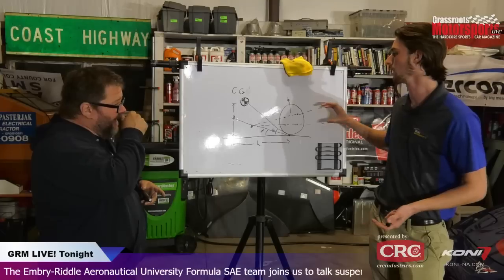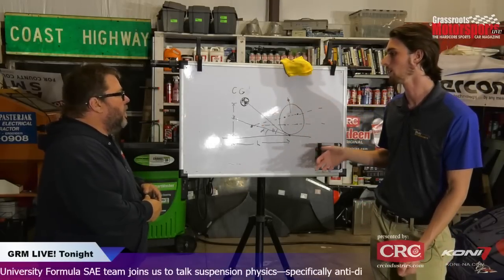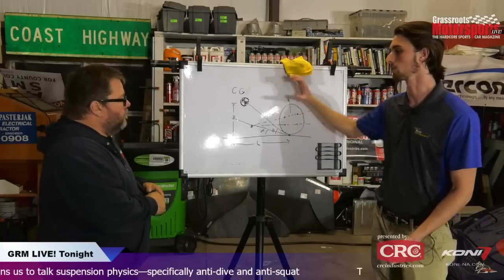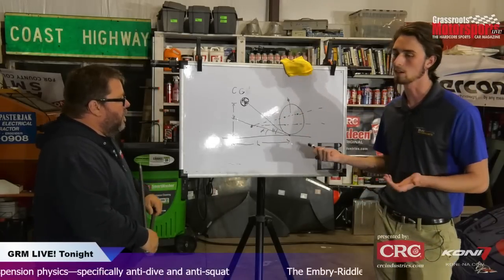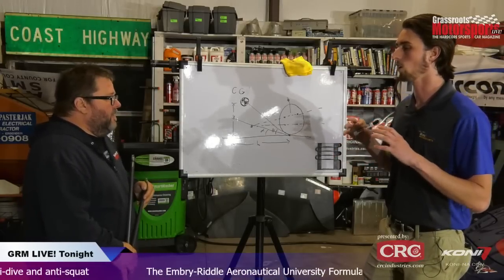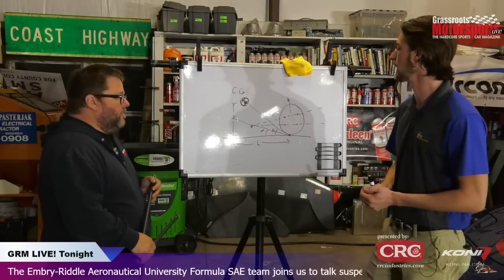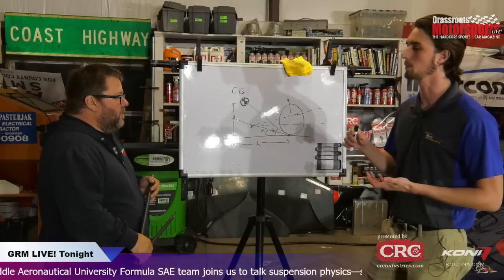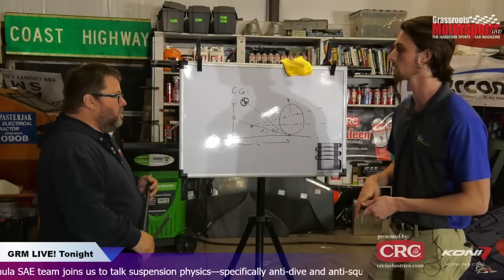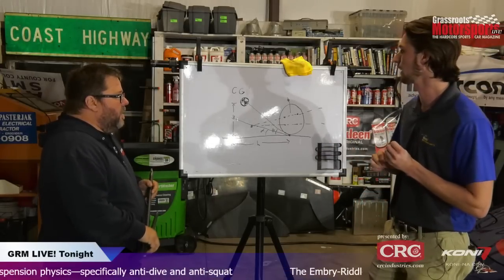And really how that works is it's all geometry. So if this is rotating around there, then there's no moment created. Whereas if this is down here, then you have that distance creating a moment when this tries to rotate, right? Okay. So at 100%, you would have instant load transfer. So when you hit the brakes, all your load transfer is going instantly to your front tires. There's no real time constant behind that. And with a spring, you have some type of time constant. A lighter sprung car is going to take more time to fully load transfer the front tires versus a stiffer sprung car, right? So that's essentially what that's doing at that level.